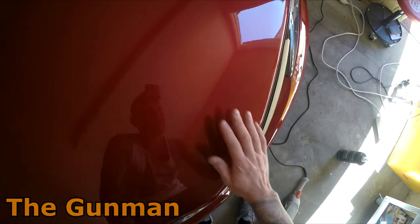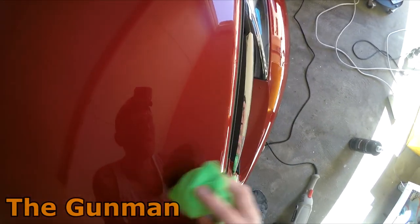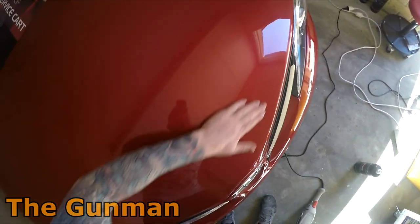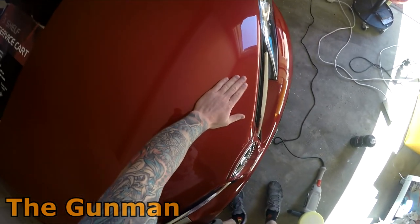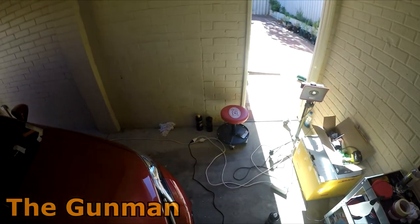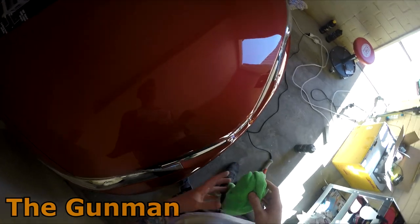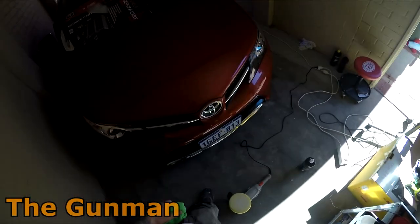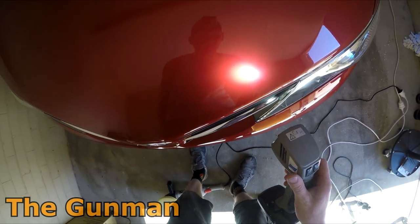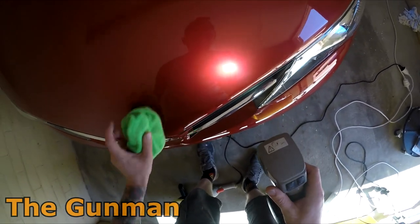So as I said, that's actually polishing up a lot quicker than what that G6 was. If that was G6 with fully cured paint, so don't forget that this bonnet has been sitting out in that West Australian sun for over a month, copping an absolute hiding. And usually the harder the paint, the harder it is to polish up. But that's actually polishing up really quite fast.